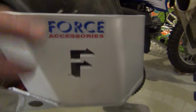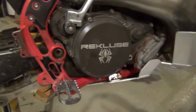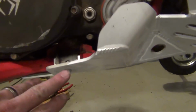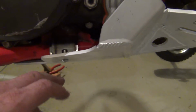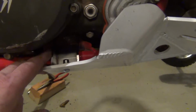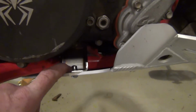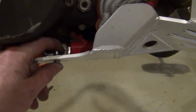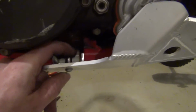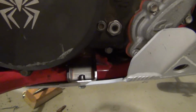And so Force Accessories, it's heavy duty. I think it's going to last. It's well made. I think it bolts in, simplistic. I guess the only downside would be shearing on some rock these side bolts, but without a bolt in there, I checked, that was pretty well wedged in there. I don't think you're going to lose that piece. So if you were to lose that bolt, not a big deal. I could see something else down the road, like the threaded insert gets jacked up or that does shear and you have to drill out. Just drill out that insert, and you could easily put a bigger button head Allen bolt in and put a nut right here. And look, you can put a wrench right there and a lock nut, and boom, you're good to go.